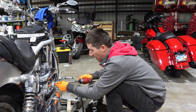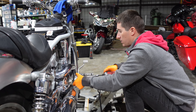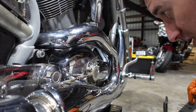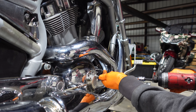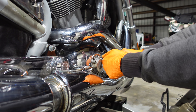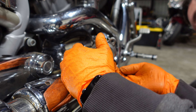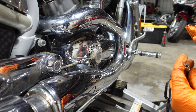We've got three 5mm allen heads right here - these are just a cover to make the clutch slave pretty. And there's your clutch slave. Now where's the bleeder? I think this is the bleeder on it - it's kind of interesting. Well that's unfortunate - I thought it was going to be easy. Maybe I'll just take the clutch slave out and look at it. Other than the fact that it's really in there - wow those are tight. No wonder the impact couldn't break them. This should just slide straight out - and it does. I'm going to say the only way to bleed it is that screw - I don't see anything else there. We'll put the bolts back in and bleed it through there.